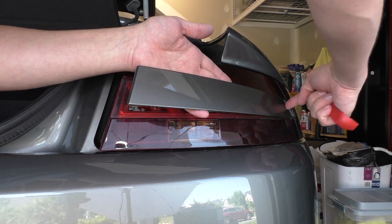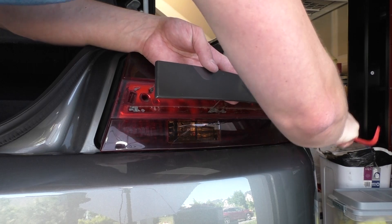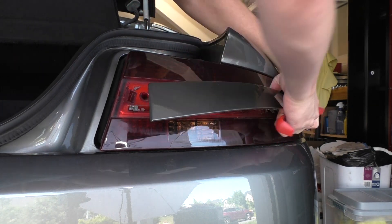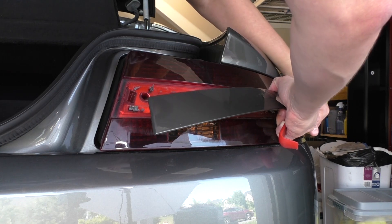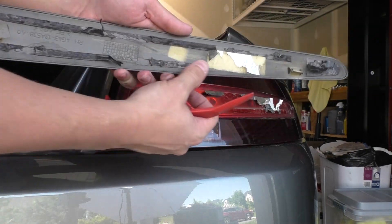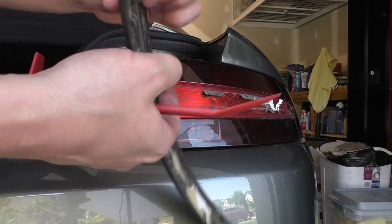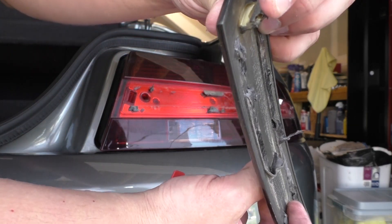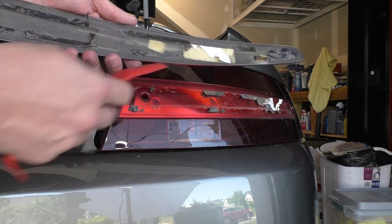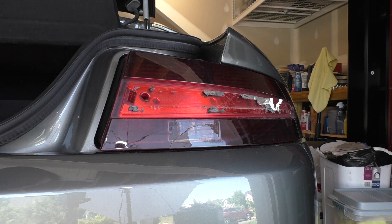I've hit that other clip so I need to work around that. This is actually easier than I'm making it look — I'm trying to reach around the camera without being in the way, so it's a weird spot for me. But it's pretty much loose and we are away. There are those strips right there, that big chunk on the end, and all this stuff. If the clip stays inside the housing, you do need to pull that off. You want to make sure it stays all the way on. Next we need to clean off the trim piece so all this old tape has to come off. It's easy to just roll your thumb along it. It takes some time and it's a bit tedious, but you need to do that so the next set of double-sided tape actually adheres to it.